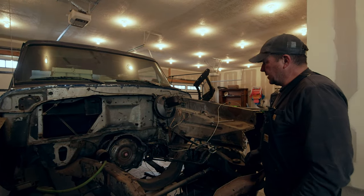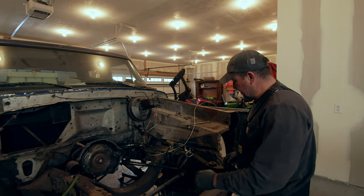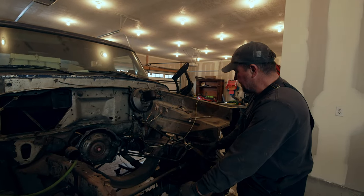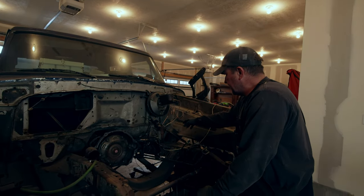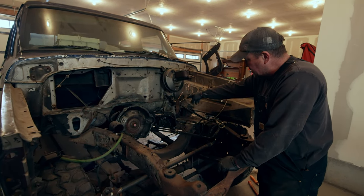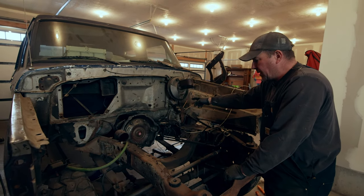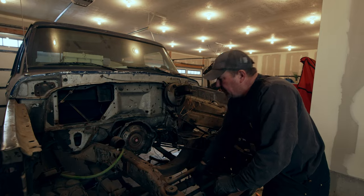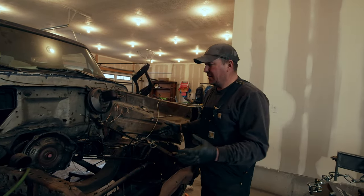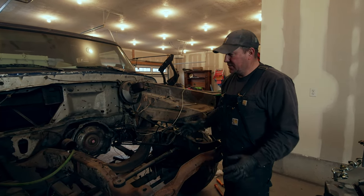Just kind of looking this truck over, I realized all the work that I have into this just to get it to this point. For instance, this is the Dodge steering gear. I had to make a custom mount, drill holes, all that fun stuff. The steering's all custom, double D shafts, whatever. I had to do the automatic transmission linkage. That's all new. Throttle cable, had to mount that up. Had to mount an accelerator pedal. This crossover steering I had to build because this is the Dodge front end, Dana 60 kingpin. And that's just kind of a drop in the bucket of the work that I've got into this thing. So yeah, it's a little nuts that we're just gonna swap frames.